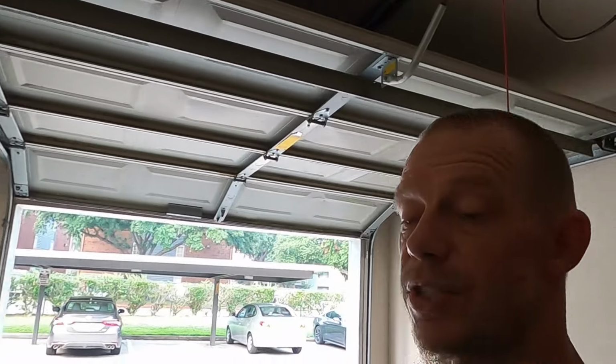Turn that thing off. So I just found that and I do need to clean that out. With all that, dude, it might end up being a PCM problem. It does kind of shed a little light on the fact that that would cause a mess up in the engine or with the PCM. So with all that, give me a few minutes. We're gonna clean this out, put it back on the truck and see what it does.